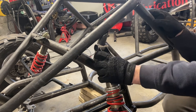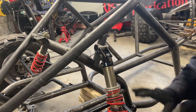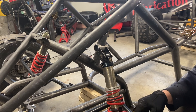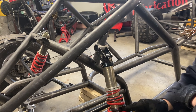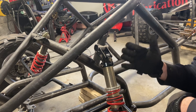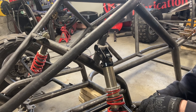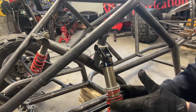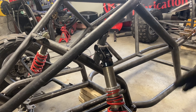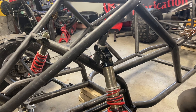Sorry I forgot to turn the time-lapse on for the welding, but you can see it's all tacked up — just lightly tacked because we don't know if this is the final place or not. Most likely we're going to change it. Now comes the fun part: we're going to see if this shock has enough stroke to handle its full travel without the bottom hitting the ground. The only way to do that is to remove the spring and put the dampener on by itself, then let it down, see where it hits the bump stop, and see if we still have clearance. Keep in mind this is all based on your tire size — these are 21s on here, we're using 18.5s, but it's very low on tread and I've let all the air out, so it should be pretty close to 18.5.